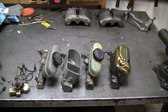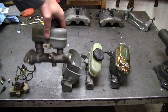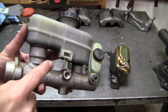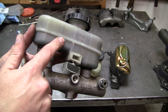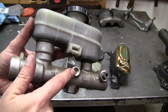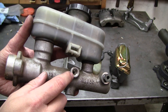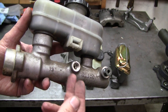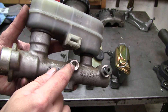First let's talk about what you've probably got, and we'll start with the 87 to 93 master cylinder. The 87 to 93 master cylinder, like pretty much any of the master cylinders after that, is going to have a plastic reservoir, a low fluid sensor, and metric threads with a bubble flare. You can look inside this particular port and tell that it has a concave, dished-out area at the very bottom where the actual brake line seals.